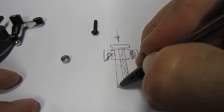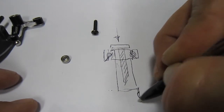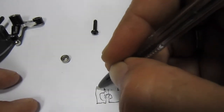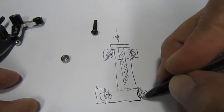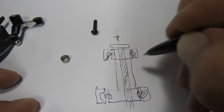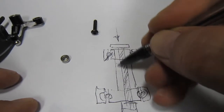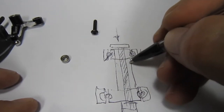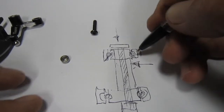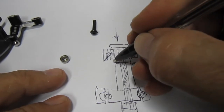So what you need to do is have a support here and between the bottom race, so that when you do tighten this bolt up against whatever it is on this side, it only compresses between there, and this doesn't move at all because you've got a fixed bit of metal in here. Okay. The problem with what we've got there is that this inner section stops about here. So we've got a gap.